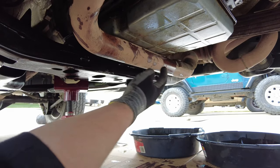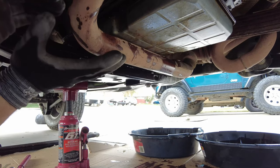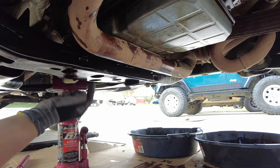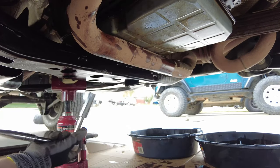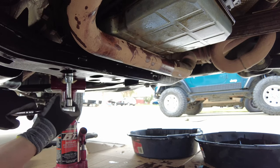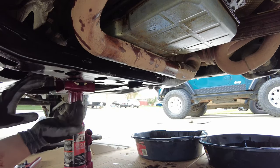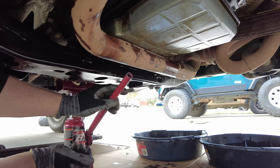The oil pan won't come out because of the cross tubing for the exhaust, so I need to raise up the transmission just enough so this will come out — we're about an inch short from the front. There are two bolts in the cross member that supports the transmission. We're going to use a 16 millimeter socket with an extension and crack those two transmission mount bolts loose, running the nut to the very end of the stud to get a little more surface area to jack up the transmission.